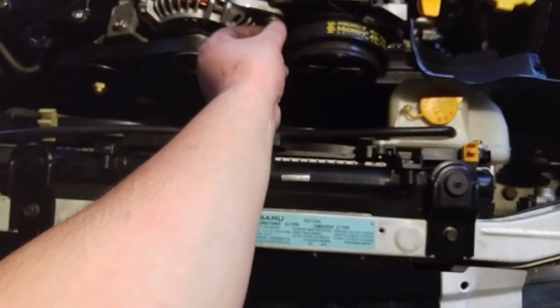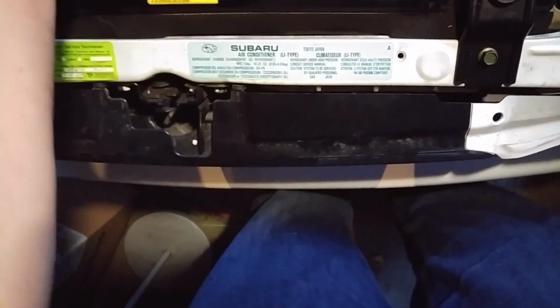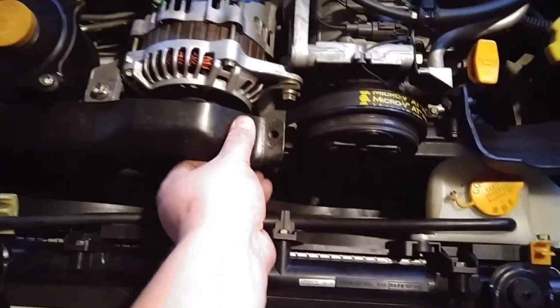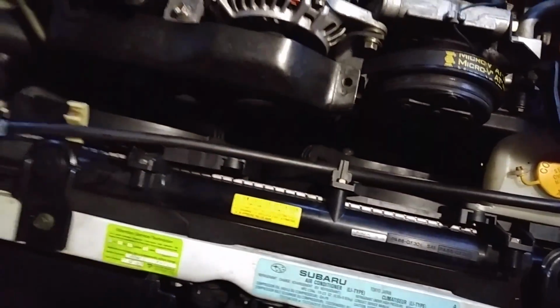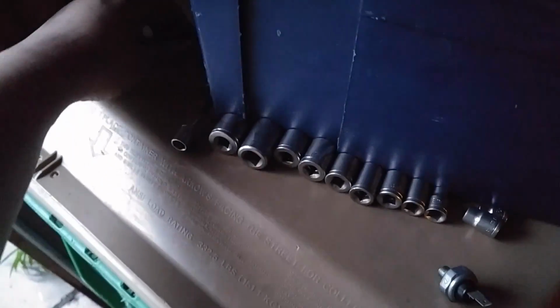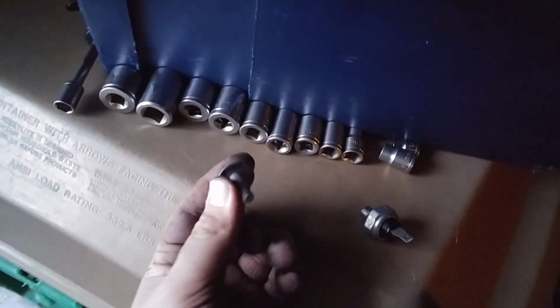But the little mounting bolts here, this is actually part of this part. This guy actually attaches to it. So it's sort of like this on there. Sorry, that was really bad filming. But that slots into there, a little fork. So don't try to unscrew that all the way, unless, well, you're gonna have to. And then that attaches to there, and then this flaps down, and then you screw that little guy back onto the AC compressor. There's just 2 bolts. So this is the big one, and it's got a little spacer there, so you can see, spacer, and that is for the far left, next to the power steering fluid reservoir.